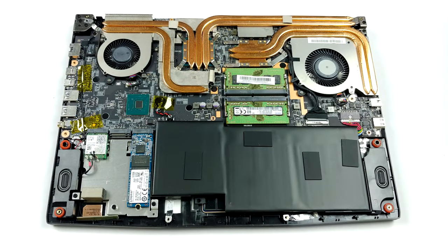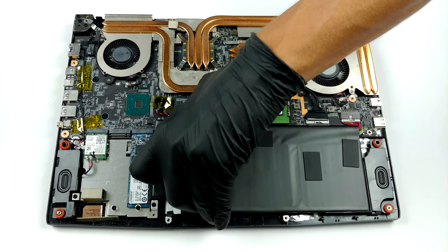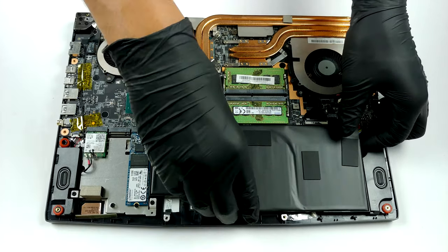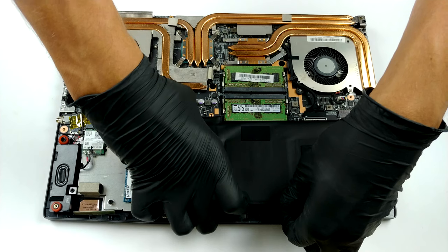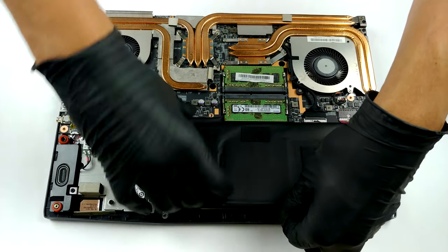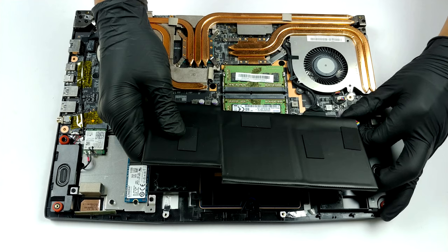As usual, MSI likes to show off its heat pipes, so they left them in the natural copper color. Here, you can see two heat pipes cooling the CPU alone, and three dedicated to the GPU. There is an additional one for the graphics memory, while two of the GPU heat pipes are passing through the VRMs. In terms of upgrades, you can put up to 64GB of DDR4 memory in total in dual-channel mode.